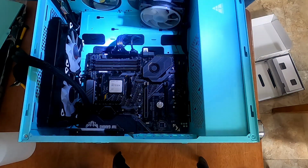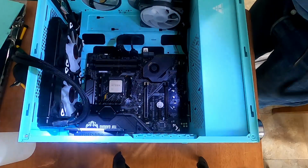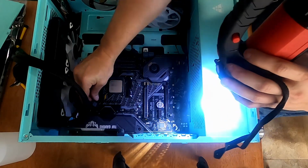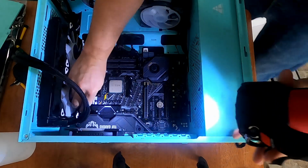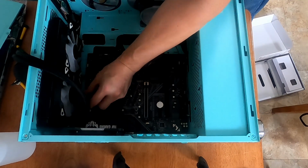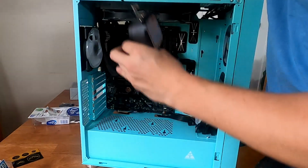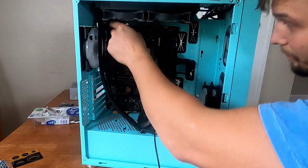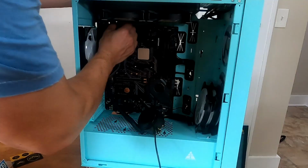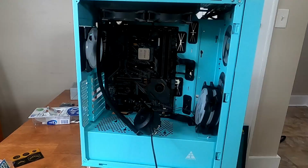Okay, now we need CPU power, chassis fans. CPU power, there's an 8-pin and a 4-pin. I'm gonna do the 8-pin. I don't think I need the 4-pin unless I'm using a ton of power, which I'm not. Might need to do this with the tower standing up so I can pull this wire out. I'm gonna put this down because it's gonna fall. Oh, did I just install that in the 4-pin? Nope, that don't go there. Oh no, I can't get it out, of course. Oh my god. I'm gonna have to take out this radiator. Okay, CPU power installed.